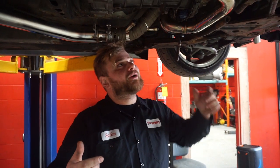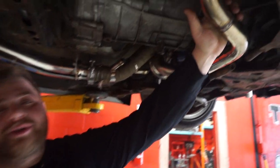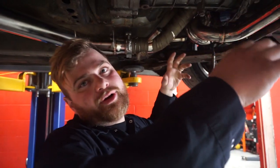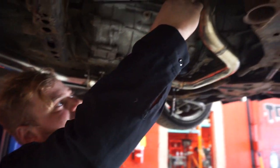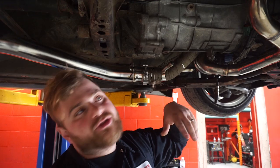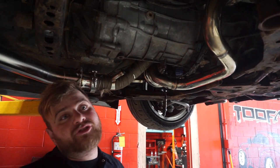Yeah, man, what they need to know is that this one is actually boosted, so slightly different. There's going to be no Y-pipe. On a normal G35 or 350Z, you just have to remove the Y pipe to get it out of the way to drop the tranny. And this is a 6-speed tranny. I'm going to be replacing the tranny as well.